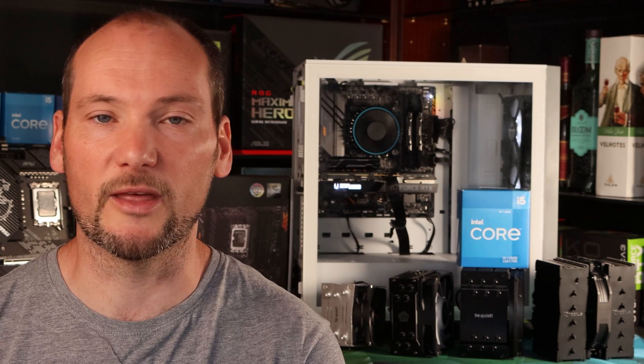It doesn't make a great deal of sense pairing these much more expensive air coolers with an i5 non-K CPU. Instead you could put that money towards a more high-performance CPU like the i7-12700 or an i5-12600K, and still have enough money for an adequate CPU cooler — you'd get a better performing system overall for your spend. The 240mm AIO performed well but is really overkill for this system; many people choose them for aesthetic reasons and that's absolutely fine — they're perfectly viable options. However, they are kind of overspend if you're looking for the absolute best value. Our recommendation is that the sweet spot of value is a 120mm fanned, 4 heat pipe tower cooler — available from $30 and up — representing a great value way to get optimum performance out of your CPU whilst keeping temperatures and noise to a minimum.